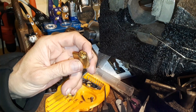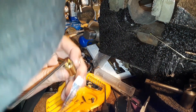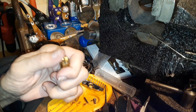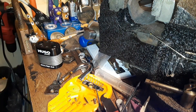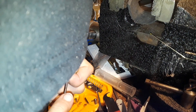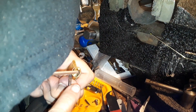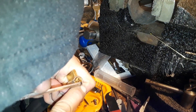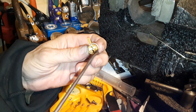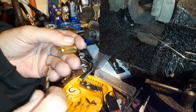I'm gonna have to pause this again — C-clip battle. Here's something I've had to do before: you take a tension wrench and put it on one end and take a flat head screwdriver, and you got the tension wrench there to give it something to lever against. That didn't work very well. Today is just one of them days when things are just gonna fall apart. I haven't had my coffee — I think that's the problem. Try not to gouge yourself with a screwdriver when you do this. There, we got a little loop — now we can pull the offending C-clip out. What a struggle.